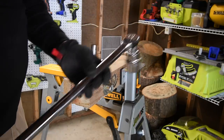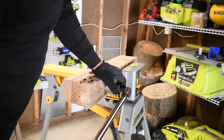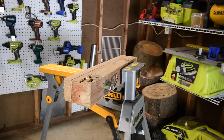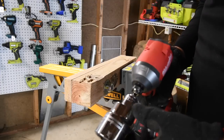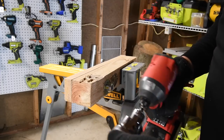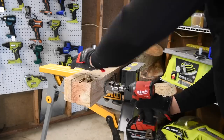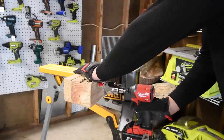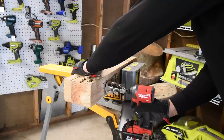We have the torque wrench set to 150 foot-pounds. Now let's see if the impact driver can loosen this fastener. I know I should be using impact-rated sockets, but I can't find the right size locally — I ordered one but it wasn't the right size and returned it.